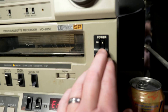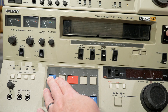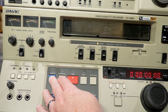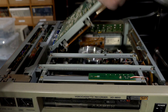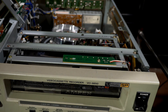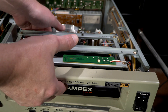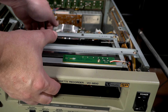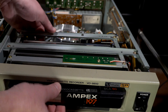To get the tape out you have to power cycle the machine. I'm going to start with a finger on the eject button and then turn on the power with my other hand. Pressing the buttons at power up didn't seem to work, so I'm going to have to take the lid off the VTR and manually extricate the tape. It appears the tape has not even started to wind out of the cartridge, so I'm going to work it backwards and out the front of the unit.